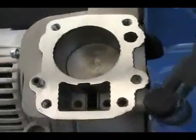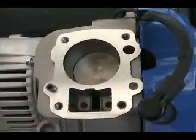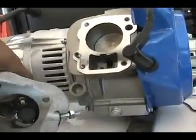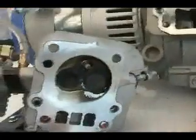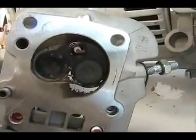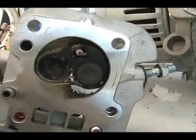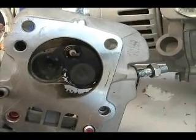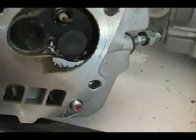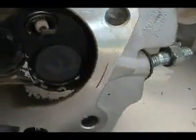One thing I did find were tiny little flakes of carbon. What that is, is from running it on gasoline for the short amount of time that it has — it built up some carbon, as all internal combustion engines do, due to incomplete and poor combustion. But running it on hydrogen has been flaking it right off.